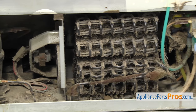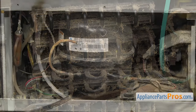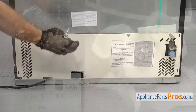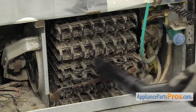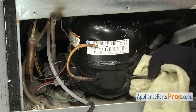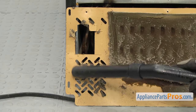Now here's that money-saving tip we mentioned earlier. If your freezer compartment isn't getting as cold as it used to and your ice cream is getting soft, it could be that your condenser coils are dirty. Dirty coils — covered in dust and pet hair — can cause the freezer to run warmer than normal and insulate the coils, preventing them from working efficiently. This can also make the refrigerator run more and cause wear and tear. Keeping the coils clean can improve your refrigerator's efficiency by 30%, saving you money on your electric bill and future repair costs. To clean them, pull the refrigerator out and remove the rear access panel, then carefully clean the coils — some may be accessed from the front. You may need a condenser cleaning brush. Also clean the compressor, condenser motor and fan blade, and wipe down everything else. Be careful not to damage anything, and do this at least once a year.